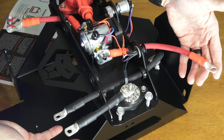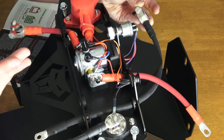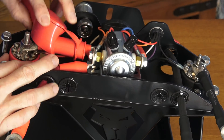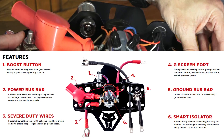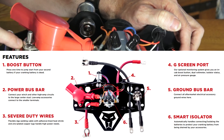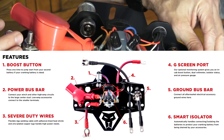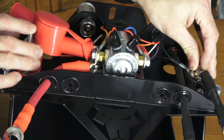This takes the post orientation into account by giving you positive where your positive post would be and negative where your negative post would be. So then you're connecting the two batteries - the negative going to the negative over here, the positive going into the isolator and then over to the vehicle. He's also added these power bus bars. The positive bar has a nice little cap for it, and there's a negative bar right here. This allows you to attach accessory items that need 12-volt power to the system. It's got screws around the perimeter for low-amperage needs, and if you have high-amp accessories like winches, you can use the huge center post. So if you need a place to connect accessories, this is a really neat option.